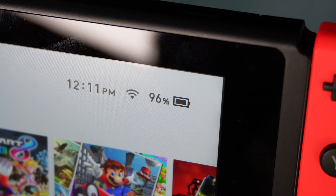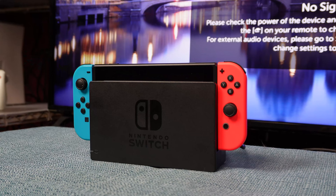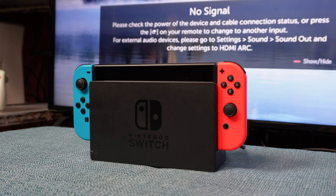Go and buy a new one. It could also be that it's not charging because the port on the bottom of the Switch is faulty, or there could be something internally wrong with the unit. This would also prevent it from working in dock mode. In that case, you're likely going to have to have the unit repaired, and I'll speak more on that in a few minutes.